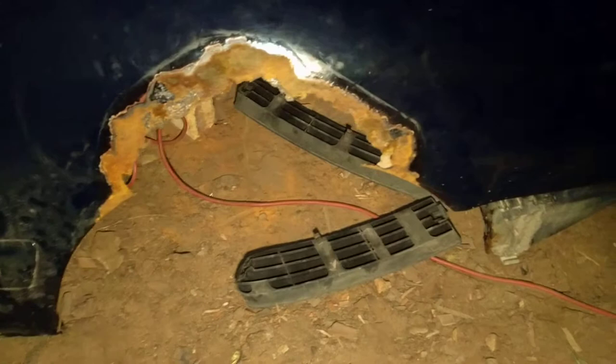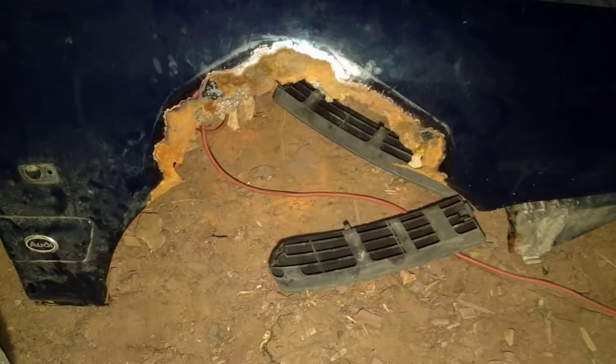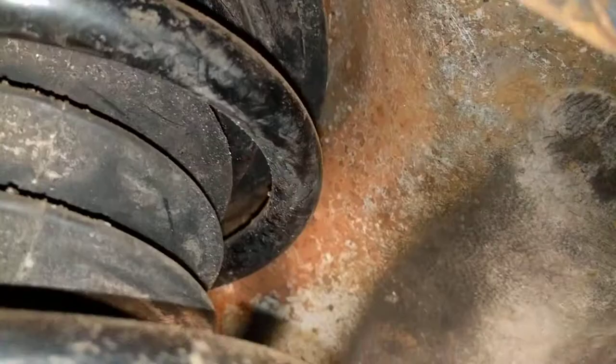One thing I should note: a plus side of doing this yourself is that on an old car like this, you really need to remove the underwing panel once in a while anyway, just to clean everything and check for rust. One of the things that happens with this particular car is the upper shock mount starts to rust. The rust is already attacking it quite badly all around, so I have to scrape it and paint it with some rust converter.